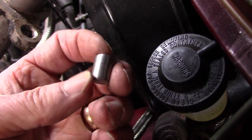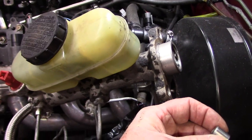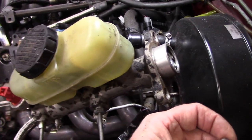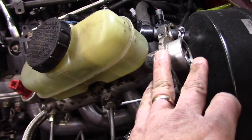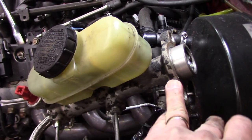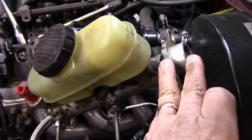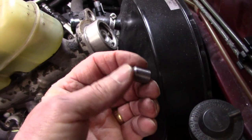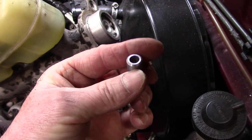I'm going to get a quote on these so they can be manufactured if you are using the Ford Explorer master cylinder. I highly recommend this because the stock Mazda master cylinder, at least in my experimentation, did not have anywhere near the volume required to operate the dual piston calipers from the Ford Explorer. This is a matched component with the 8.8 rear disc brakes and the Ford Explorer dual piston caliper front brakes — there's no calculations involved, this is the right master cylinder for that package.